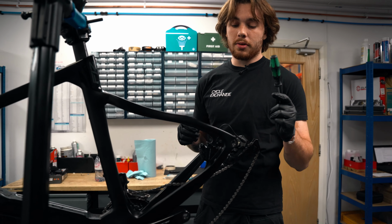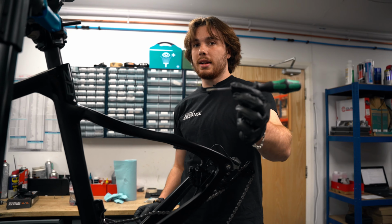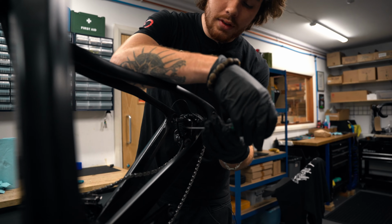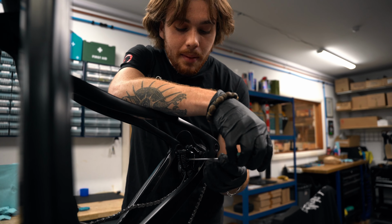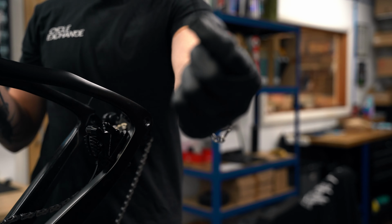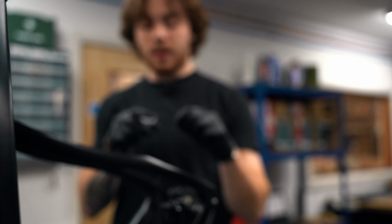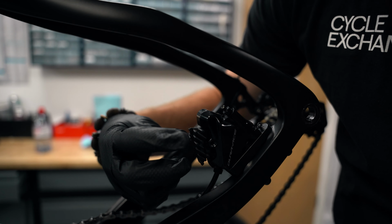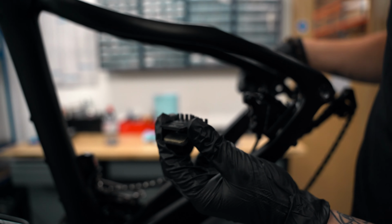Cool, now Shimano calipers, they have a little bolt. You need a flathead screwdriver. Let's get that bad boy in there. Just loosen that off. And now that safety clip and this little pin thing there, take good care of them. Don't lose them. Oh, I think I've lost the clip. Grab them. Oh, there you are. They're out.